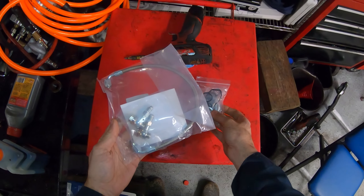Now we can pull the liner back and push it out of the way. The reason we do this is because there are a couple of black clips here — one up here and one down here — which we need to remove before we can take the bumper off. I've got a nice fancy tool for body clips. You can get in here and pull the center part up and out. It's also got a cutting edge, so if you're having trouble you can just cut right through it and use a zip tie instead. If you don't have this tool a screwdriver might work, but the chances of success are low.